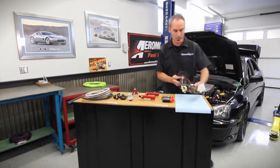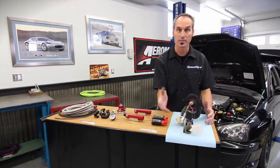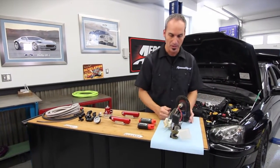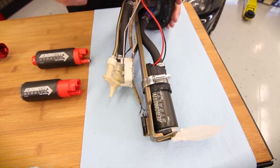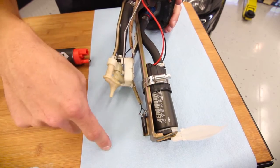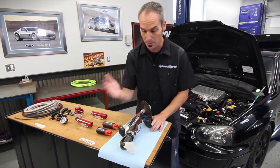This is pretty typical of what you're going to see for an assembly system inside a tank in modern cars. You've got a hanger here — it's going to mount your pump. You're going to have your sock filter down here. There's going to be a return line for the system, and this is your sensor for your fuel gauge so you can see if you're running out of fuel.